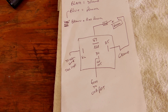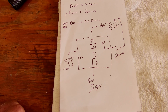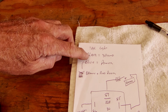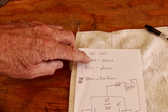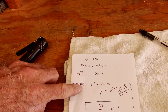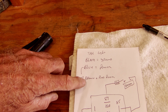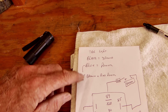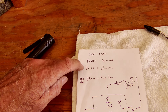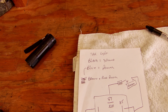Since the relay is going to be so close to the battery, we'll probably just go right back to the battery. That's what the relay is all about. So the next step is finding out where the tail light is. I've looked at the schematic — the black is the ground and the blue wire is the power. That blue wire is actually a short wire. It's brown and red, then there's a junction and then it turns into blue, giving power to the tail light. So we're going to find either that blue cable or the brown and red power cable.